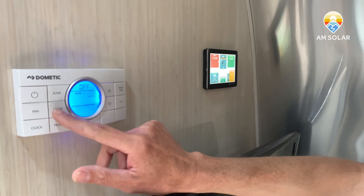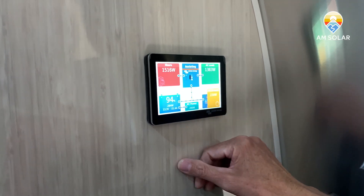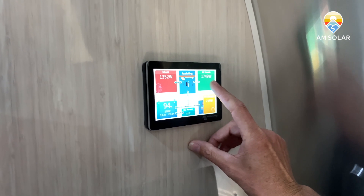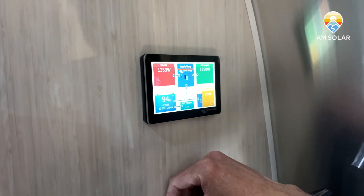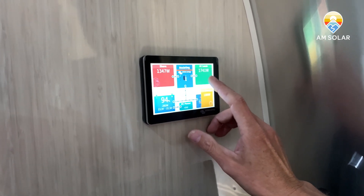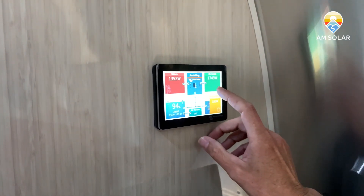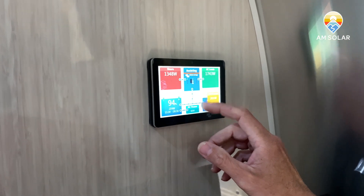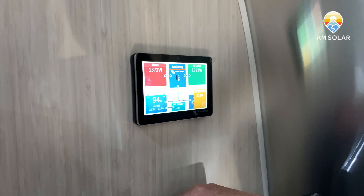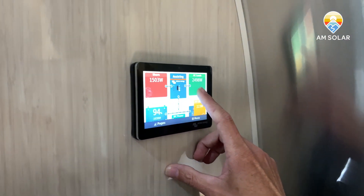Turning zone one on. You'll notice our AC loads spike up, but we didn't increase much on shore power because it understands we've only got 15 amps to work with — so now it's assisting and pulling that extra power out of the batteries. This combination of 1700 watts is one air conditioner actively running and the fan of another. We haven't even hit dual continuous running yet — there's still a compressor to kick in. There we go — 2400 watts. We've now got the continuous operation of both air conditioners.